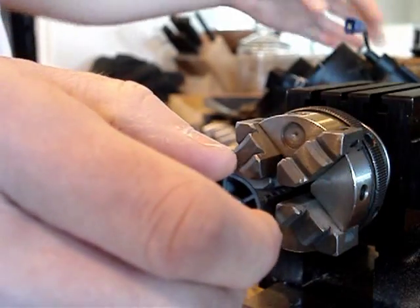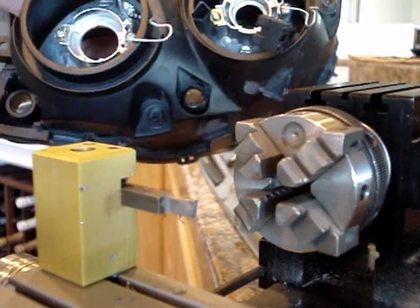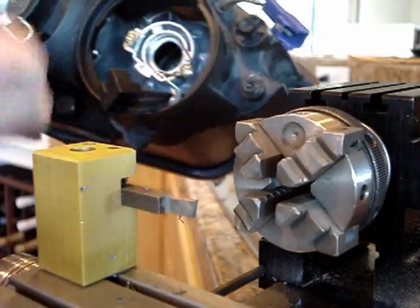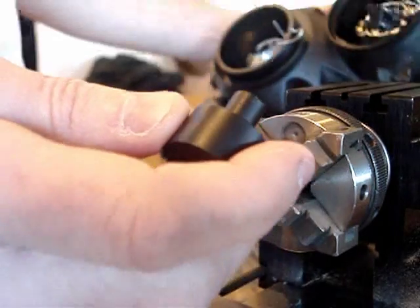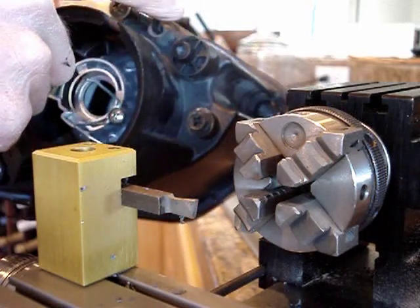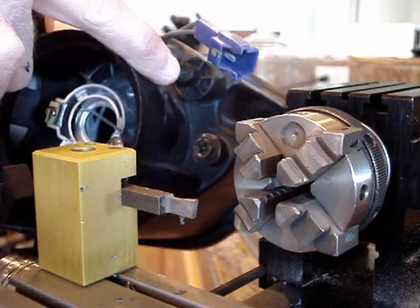It holds the screw. I can't really move the camera, but if you look in the background there you can see there's a headlight housing for the motorcycle. You can see right here is one of the mounting points, and then I have the broken one in my hand. There are threads right in here, and on the housing I bought off eBay one of the holes had stripped threads — unbeknownst to me and probably to the seller who recycles these. So I'm going to drill this piece out.